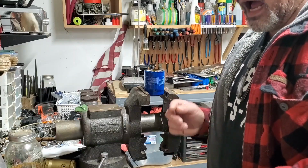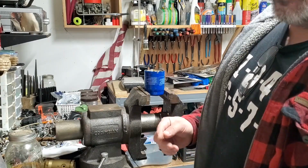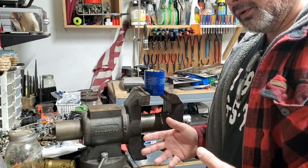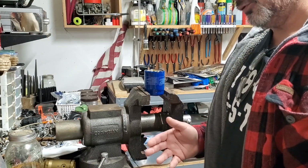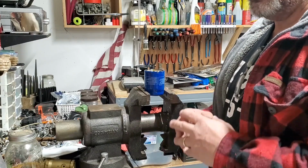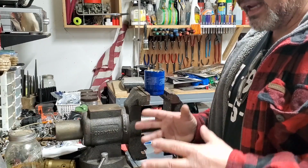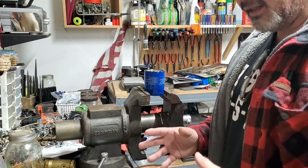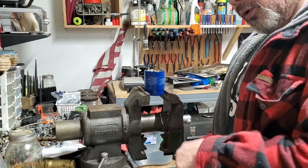That meant that it had high oil pressure on the discharge side of the VTEC spool, which was kind of weird, because how can that be if my oil pressure is too low? That's why I made the gauge assembly and all that, so I wasn't dismissing what the PCM was telling me, but I needed to see it actively work. I needed to see everything that was involved, which led me to low oil pressure.